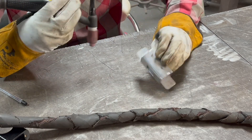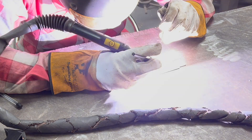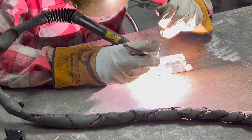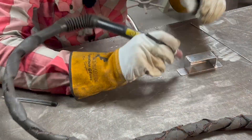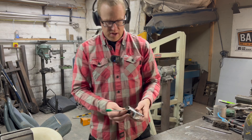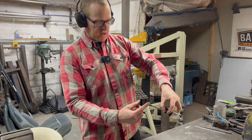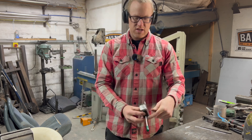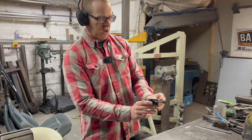I've got to weld up the corners, drill a couple of holes in each of the flanges, and then work out exactly where that's bolting up to the dash. Clamped it up a little bit to close up the gap, and now it's time to TIG weld that up. Happy with that — looking good. And there we have it: the housing all welded up. Just a few holes to drill, but let's check how it's going to work — perfect. That's a really neat way of using an off-the-shelf part for a custom application.